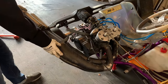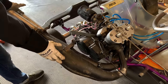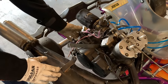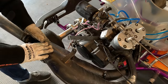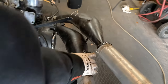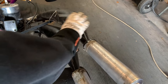I got these pipes in pretty much their final position. They are going to come up a little bit because there's only about two inches of clearance over the rear wheel — I want a little bit more than that. But they're pretty much in their final position and it looks so much better than before, just the way they're coming back here. The next step is I've got to make a mount, probably from this rear engine mount, that's going to come up and mount to the pipe. These pipes actually attach with two rubber mounts on the bottom pipe, but they don't line up with this pipe anymore because of the movement I did. So I'll have to cut those off and move them over to get them to attach again.